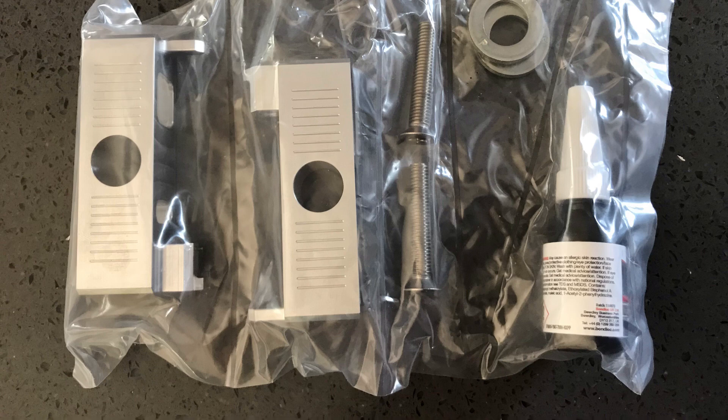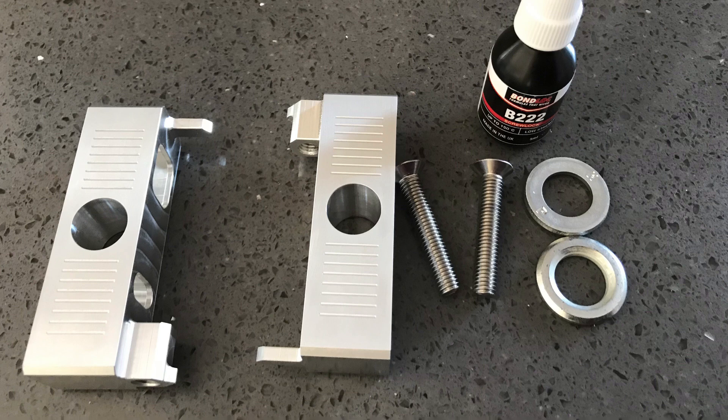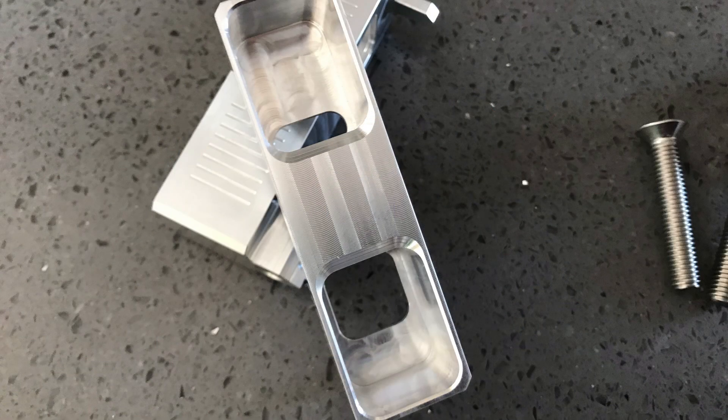If you look at those blocks, you've got a peg sticking out on the right and a thicker peg at the bottom. They are effectively spacers - the front one holds up the block, and the rear one is the threaded hole into which go the star bolts, and that is what accomplishes the tensioning. Also included is some thread lock. The purpose of that is purely to stop those star bolts vibrating out. Once you've tensioned your chain and tightened up the axle, nothing's going to move, but a bit of thread lock just to be sure.